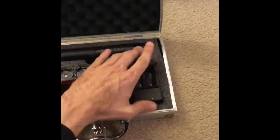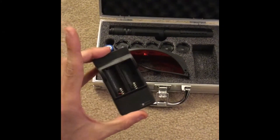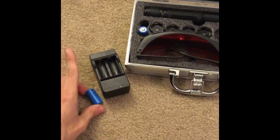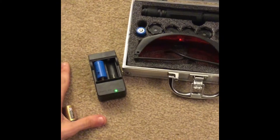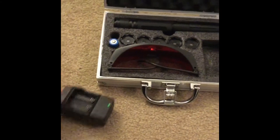They also come with an 800 milliamp charger, and this thing absolutely sucks — it takes literally about 90 minutes or more to charge each battery. If this is all you have to work with, you can still get the job done. Don't load both batteries in at one time though, just put them in one at a time. Also, if you leave it connected like this, it's going to discharge your batteries, so don't do that.